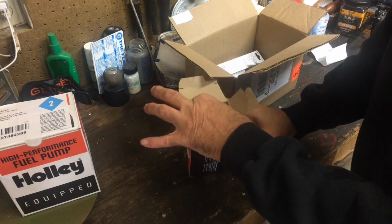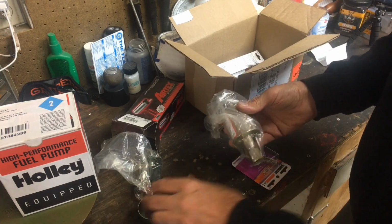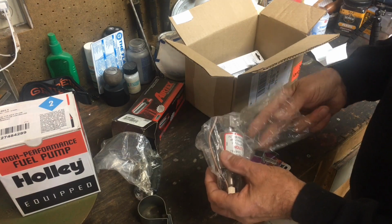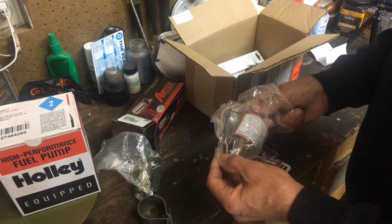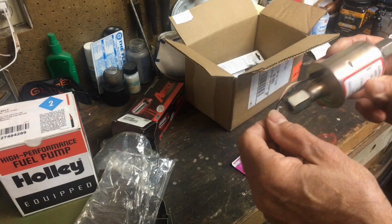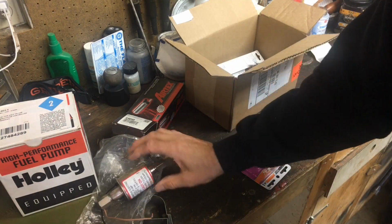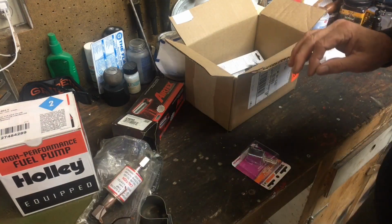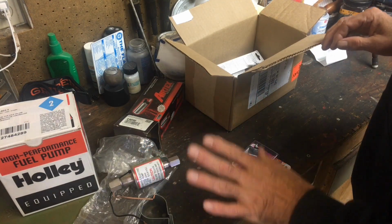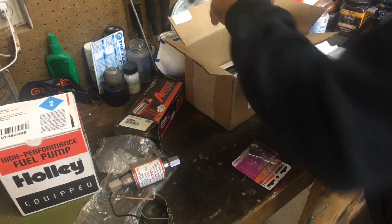and be able to pump fuel through the mechanical pump with this, up to the fuel filter and the carburetor bowl. I'm hoping that this will make cold starts much better. I fill up the bowl, give her some pumps, and have gas up there to the carburetor a lot quicker than what we have by cranking on the truck now and pushing down on the gas pedal. So I got this guy. I'm going to have to cut the steel line, and this will be installed, like I said, after a filter and before the mechanical pump.